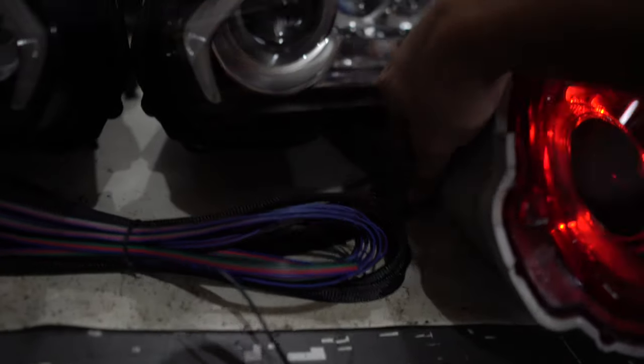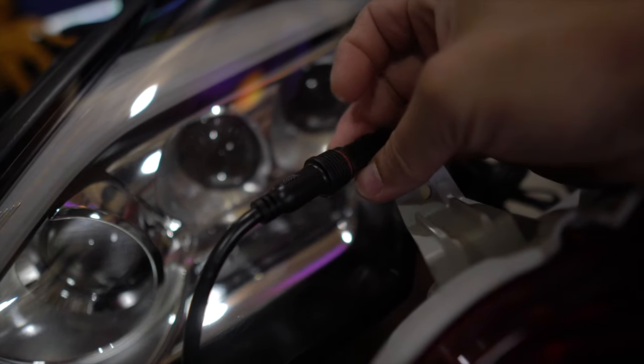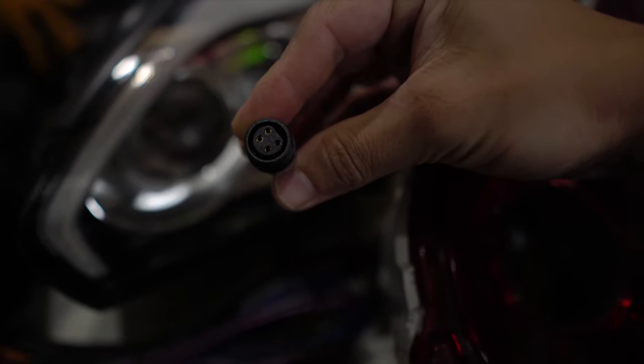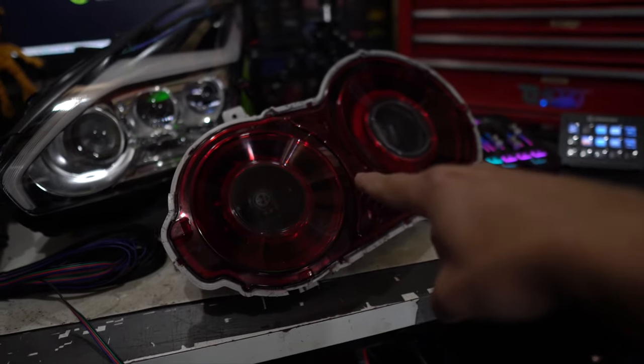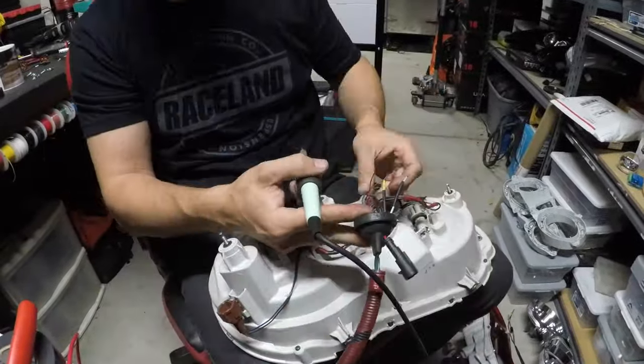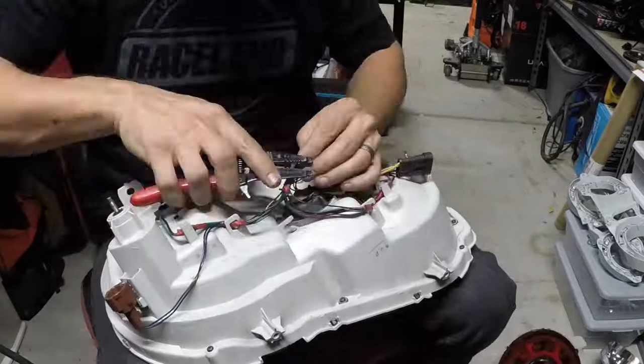Following the wires around, they lead to a connector that I want to be easy to take on and off — it's a four-pin connector and I can unplug it with one hand. Those little pins provide power, ground, and the two different 12-volt show mode inputs for the ghost module inside these taillights. Over the years I've realized you can make that very complicated for the installer, so you want to make your install easy for the customer or the shop doing the install — foolproof, so all they have to do is push that one connector on and it's hooked up. They don't have to know anything about ghost modules or programming.